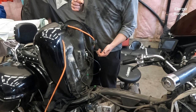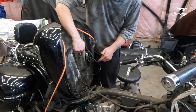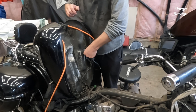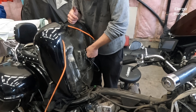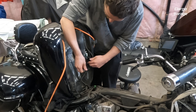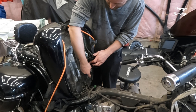Another way to make sure your float is facing forward: the wire should be directed towards the inside of the tank, or towards where the frame would be — you can see the wires coming out with our connector. When you get the tank back on the bike, double-check for leaks. You don't want any gas leaking out, especially over a hot motor — you have heat, you might have sparks, it's a bad situation. Tighten the bolts fairly equally; you don't want to crank one all the way down first. Pull it in nice and flat so you don't cause any leaks.